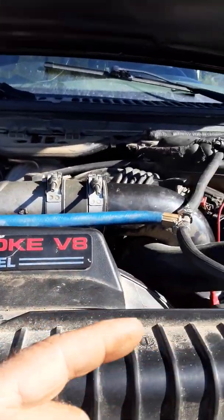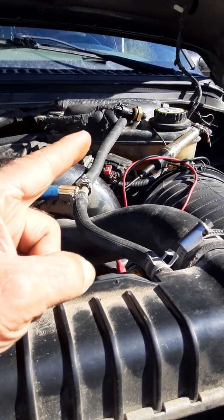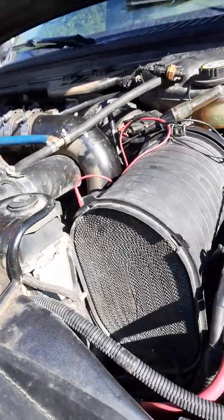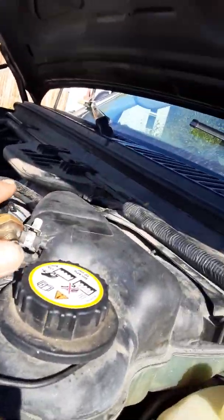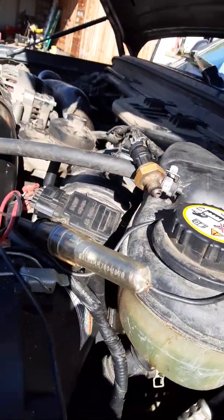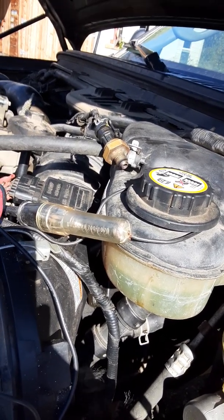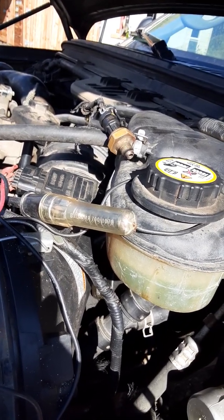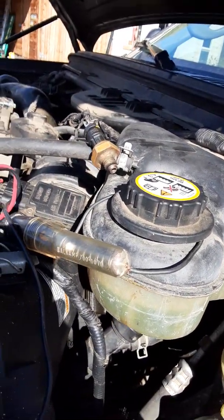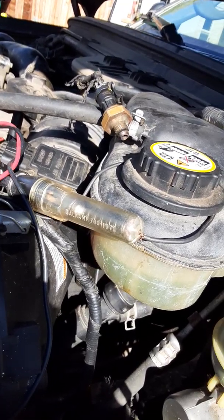It could have been another sensor. There are several that go along with the electronic throttle sensor and foot pedal — that's a common one to go bad. I started with that one and it checked okay. So I found a common test point to put my meter on where I could see the five volts. I knew it wasn't five volts — it was one volt. I went around and unplugged sensors one at a time. I have the schematic — I'll put it in the description, I got it from the PowerStroke Diesel Forum. When I pulled the MAP sensor out and measured five volts, I went in the truck, turned the key off, turned the key on, and once I saw that wrench light go out, I knew the problem was solved.